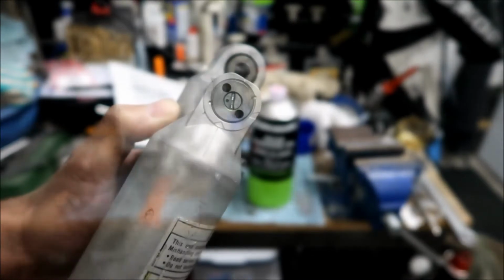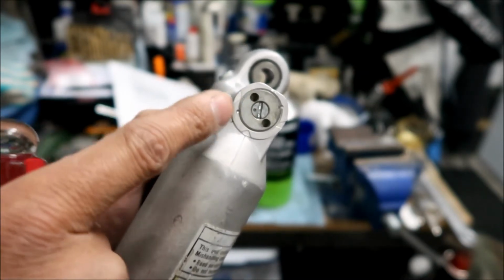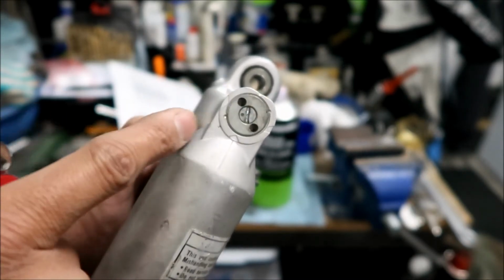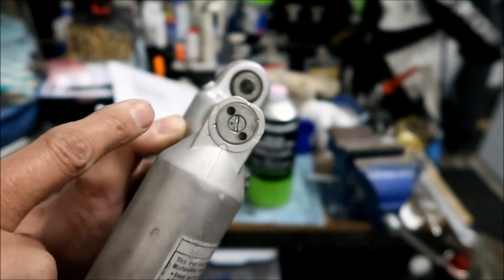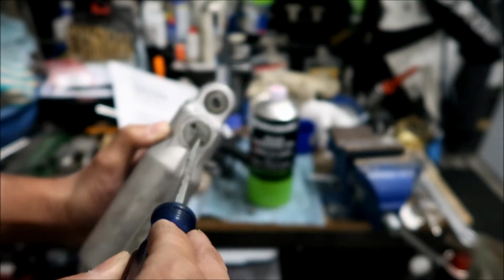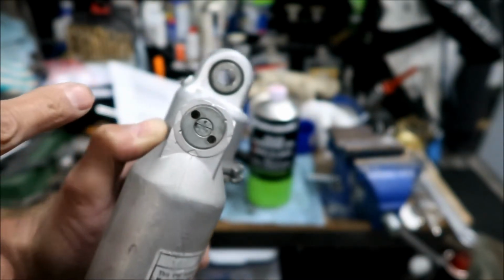There's one more adjuster I forgot. I think this is the compression adjuster. To put this on the softest setting, it says you have to put it on the lowest or softest setting. You just need to point it at 12 o'clock. Right now it's in the highest setting. You'll see these triangular marks here, and they get bigger or smaller. The one in the 12 o'clock position is the softest, or the lowest. So I'm just going to turn it counterclockwise, or I could go clockwise too, until we get to the 12 o'clock position. Just like that. Got it.